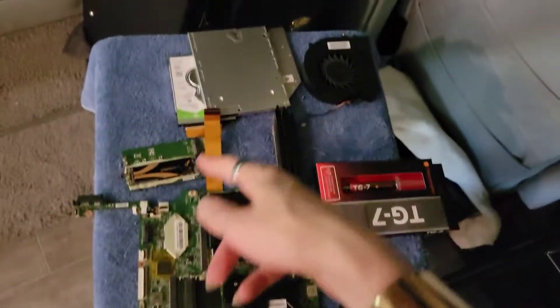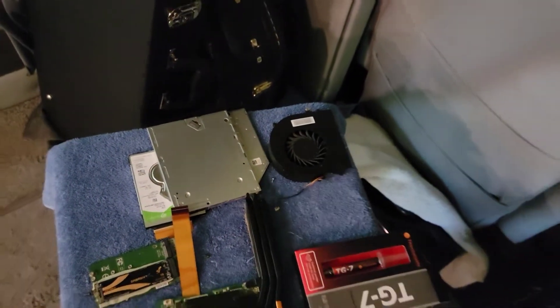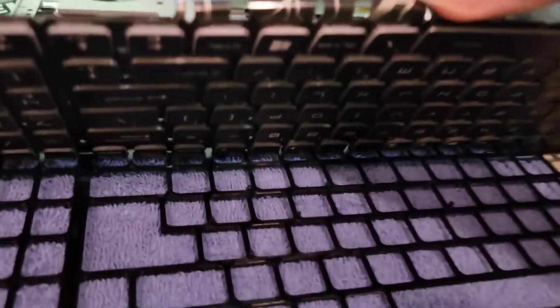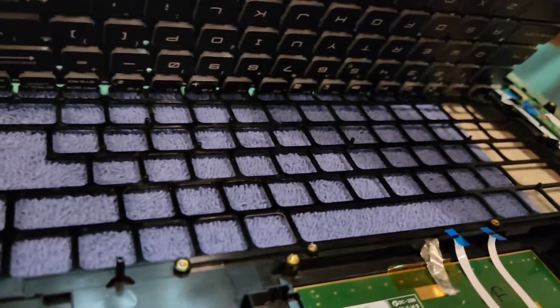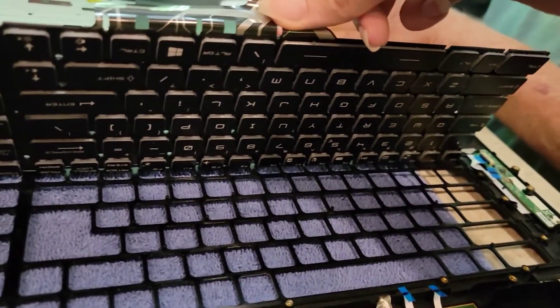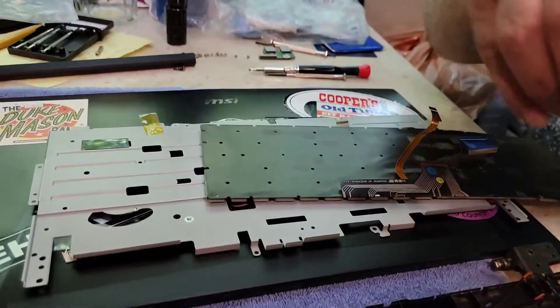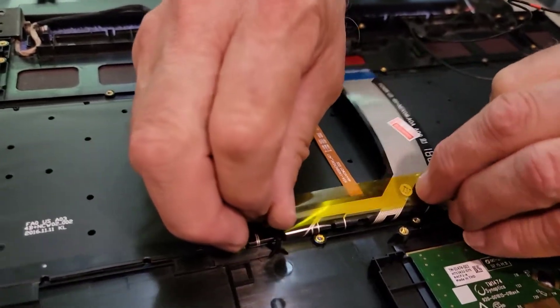In order to get to this point, we had to take everything out of the computer including the main shell which surrounds the motherboard — hard drives, solid state drives, fans, IO board, DVD drive, everything. So this is the new keyboard. We just put it in here. It lifts off like that and fits into these little grooves or key cut-outs. This is actually all one piece — this plastic base plate at the very top of the computer when you open it. It just holds this and a couple screws, and everything is pretty much reassembly from this point. We had to put that steel plate back on and some tape to make sure everything goes down properly.